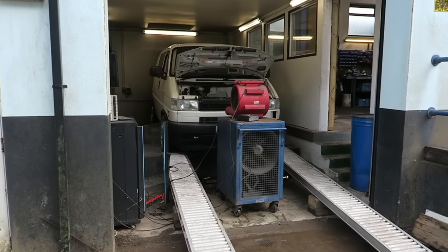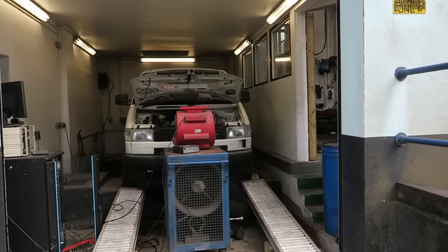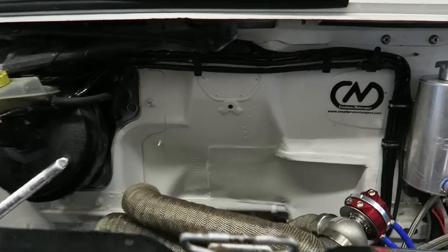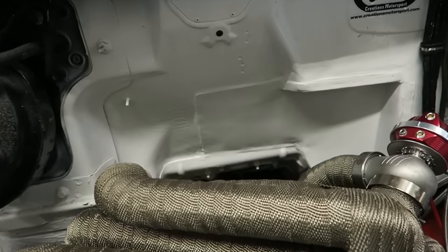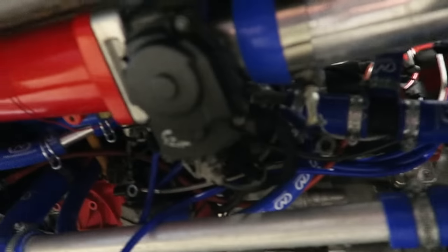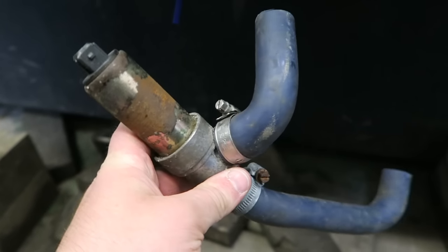Lots and lots of airflow to keep things nice and cool. Guys, this feels awesome seeing it up there now. Bed the rings in, get it all running right, get an MOT on her. Coming down off the revs, we're noticing she's cutting out and the advance is going up to about 30 degrees plus, which means she needs more air on idle. The VR6 throttle body is sealing up quite nicely, which is good. Putting a Mark II idle control valve back on.